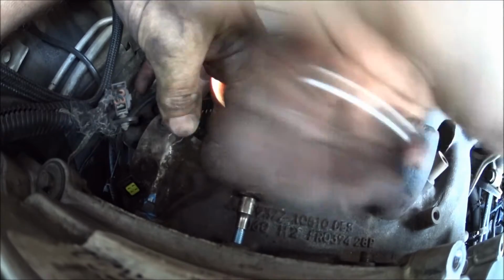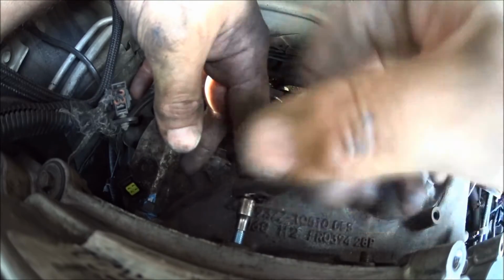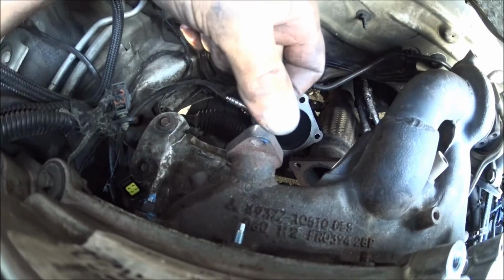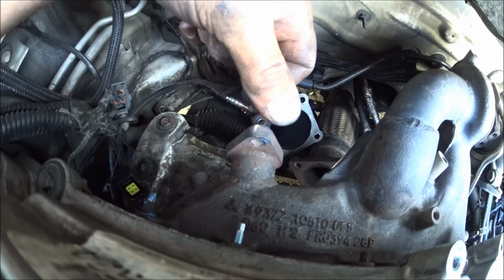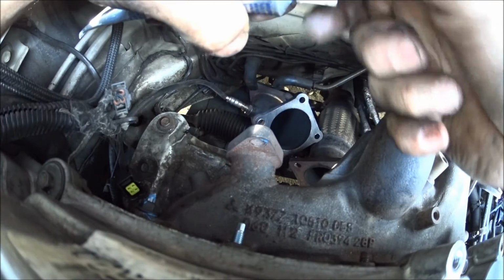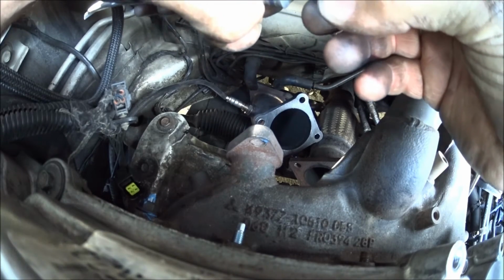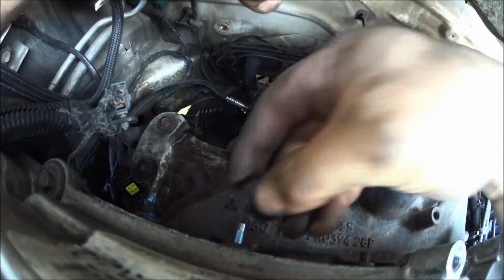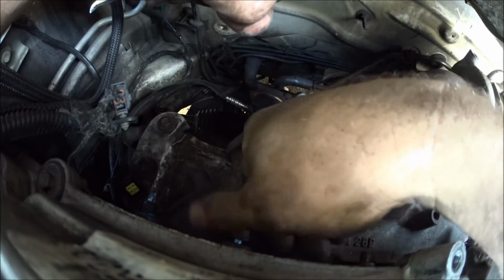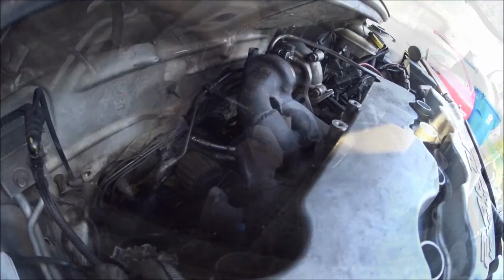As you can see, the studs have a little nut piece on the top, so I'm installing them with a ratchet. Nice and tight there. Now, these come with nuts. I put a little bit of silicone on them too. If anything, you're going to see some boil. You get a little bit in the threads. You tighten them up once and you're done. It's not, let's come back and retighten them after a heat cycle or two and make sure it's all right.